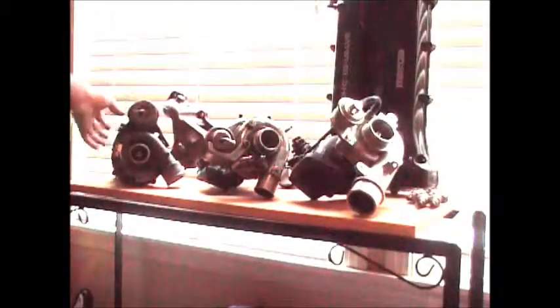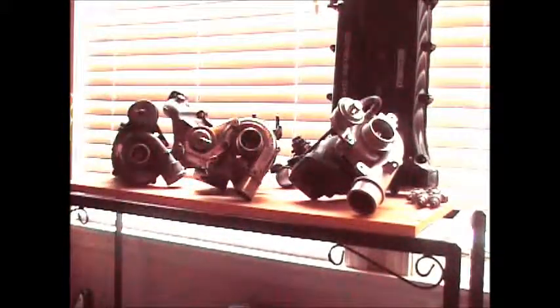On most turbos, you're going to see a couple holes on it, like this, and then feeding tubes. That's for oil and coolant cooling. Basically every turbo that's cooled one way or another has an in and out, and it's fed from somewhere, and the coolant just runs through little jets that keeps it cool, and so does the oil, and some turbos are actually lubricated from the engine. So I mean, that's basically it.